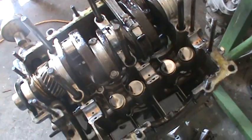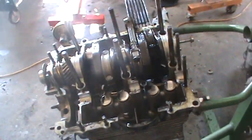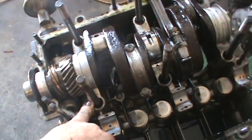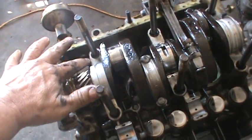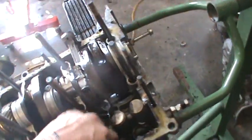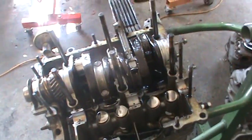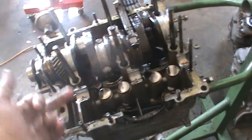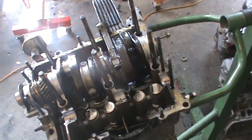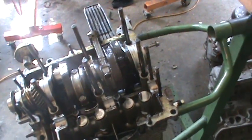Somebody wanted to know the age of this motor — I saw a stamp: 1010. I don't know if that was when it was first built or when it was last warrantied. Another thing I noticed is there are no seals on the studs — no seals at all. There's a seal that should go there, and you really should use it because it has a lot to do with how the case sits together. That could very well be the reason the cam was pinched so tight. So we're going to degrease it, clean it up, and go back with the reassembly. I'll try to get you guys on that video too. Hope you enjoyed the teardown — you guys have a good one, thank you.